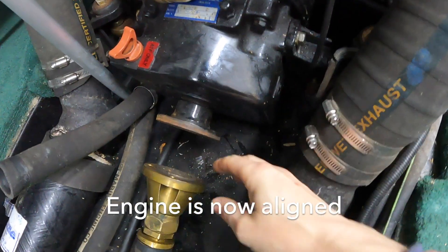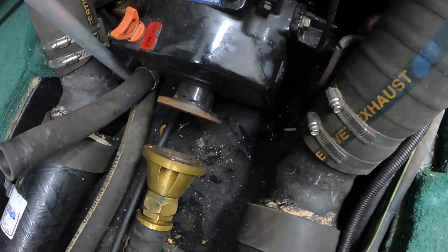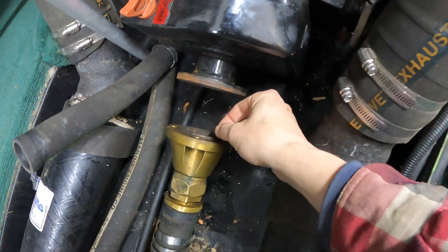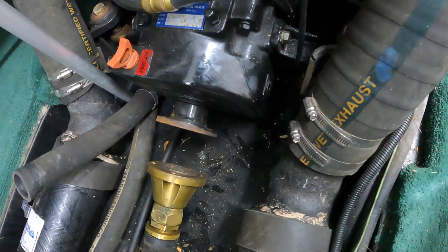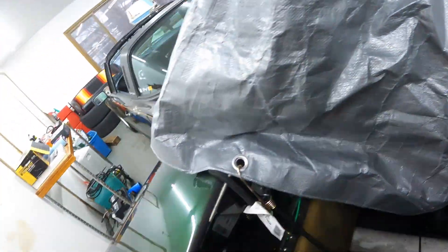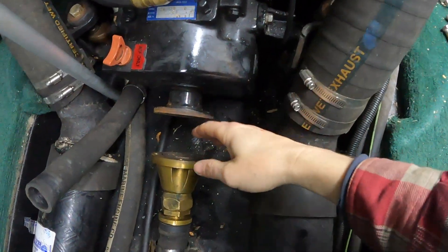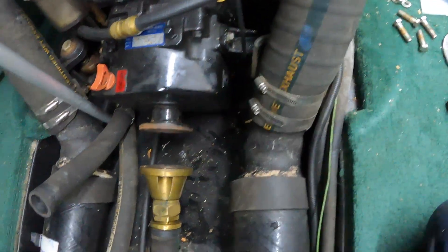Skipping ahead a little bit — I removed the cotter pin and the castle nut from the coupler. To do that I had to use side cutters and a hammer to hammer the cotter pin out. Then I had Sarah go underneath the boat — you can see we've got a lot of clearance back there. She used a 2x4 to prevent the prop from spinning, and then I put a socket on it and backed that off.